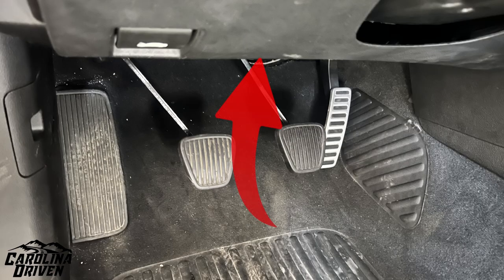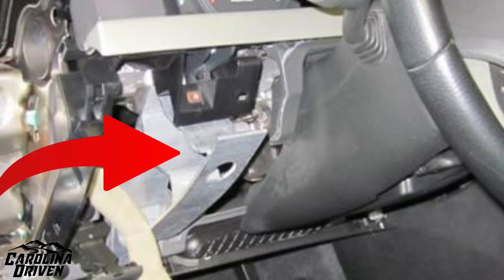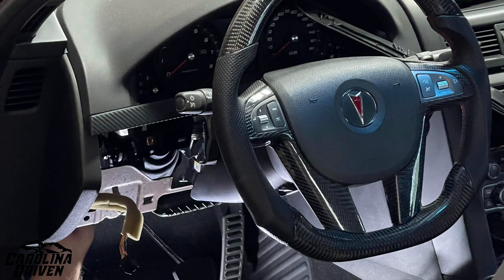When you're sitting in the driver's seat, there's the kick panel where your knees go — pop that off, it's just clips. Underneath that, from the steering column to the actual firewall, is another black plastic piece; pop that off, also held in by clips. Next up are two aluminum pieces — I don't technically know what they're called, maybe knee guides for accidents — but you'll see them: it's two 8mm bolts, pop those off. The bracket they're bolted to comes off as well — it's six Phillips head screws: two on the right, two on the left, and two on the bottom by the air duct. Just pull that out.